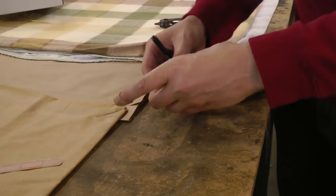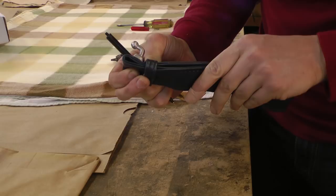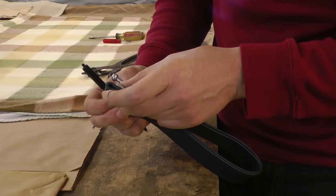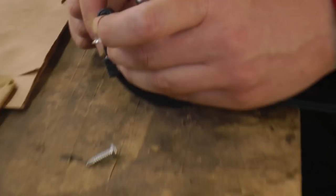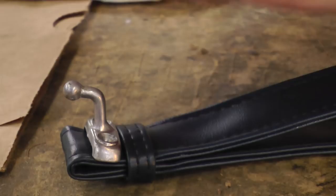Now, like I said, you see it's kind of thick between the hook and the new material, if you can see how thick that is. For that screw to pass through here and then come out the other end and screw into the body might be kind of tough. So what we need are some long machine screws or self-tapper screws. These are much longer and just enough to stick out and attach to the body of the car.